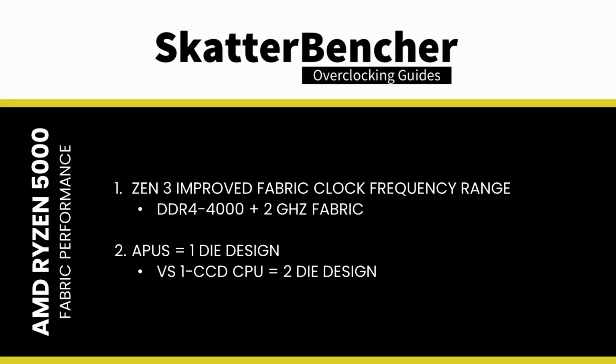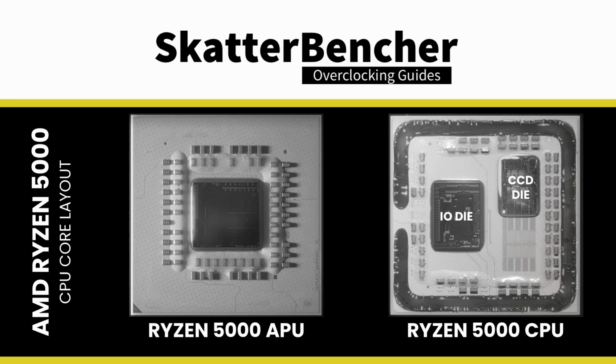Second, APUs in particular have a design advantage as well. The CPU cores and cache, the integrated graphics, and the I/O are all integrated into a single die. That's different from a single CCD Ryzen 5000 CPU, for example the Ryzen 5 5600X, which still has a separate I/O die on package. This effectively means the Infinity Fabric is entirely integrated inside the single die and thus allows for a much higher overclocking range. Whereas we sometimes struggle to run in synchronous mode at DDR4 4000 on regular Ryzen 5000 desktop CPUs, on this APU we were able to quite easily run at DDR4 4533 with a synchronous fabric clock of 2267 MHz.